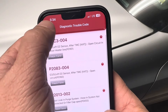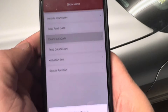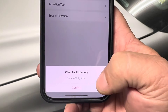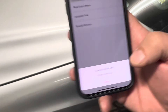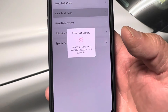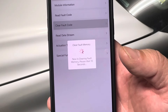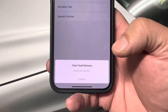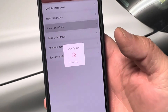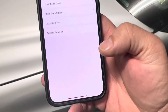There's freeze frame data available as well. I'm going to clear the fault code information. It wants us to switch off the ignition and then confirm that — ignition off confirmed. It does a 10-second wait. Not all vehicles require switching the ignition off when clearing fault codes; it depends on the manufacturer. Now it asks to switch it back on and confirm.